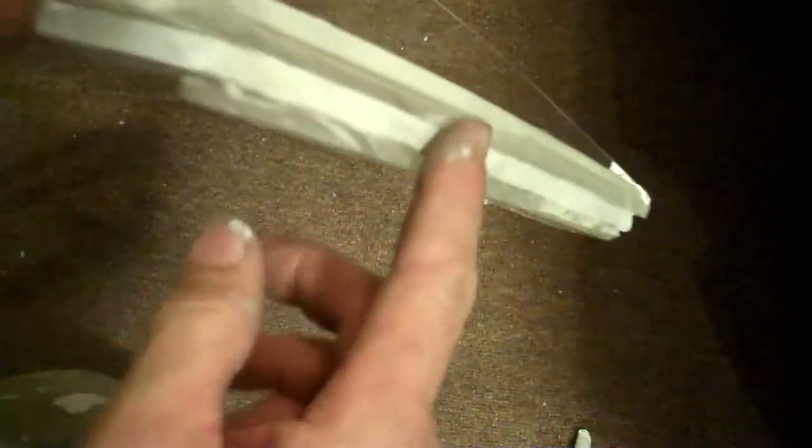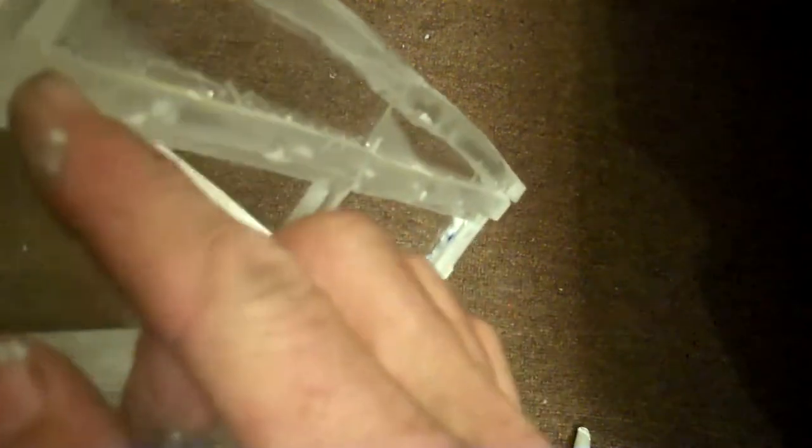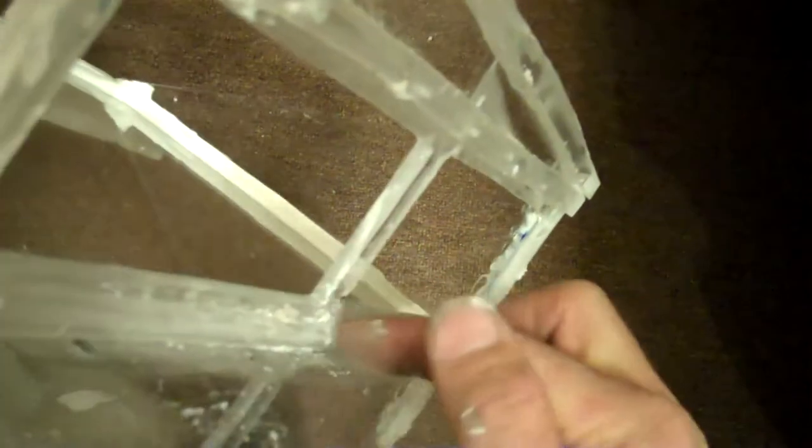And so I've got the little build-up on the front of the couple layers to help it sit on the shelf. And on the back, it's the single sheet of plastic, but then I put an extra little strip up here to widen this out so it'll have more surface area to put the caulk on to hopefully get a good seal on the lens cover. I put a strip here and a strip down here, again to hold the bracket to hold the lights in, and we'll use just regular old caulk around there so that if you lose a light, then you can always pull it out and re-caulk it. The 5200, boy, once that stuff sets, it's not coming out. So we're going to just use regular window caulk.